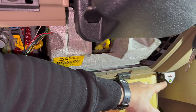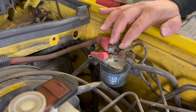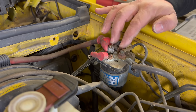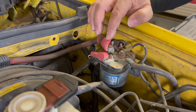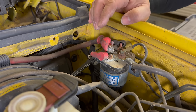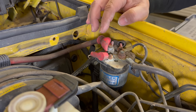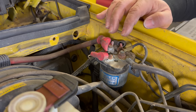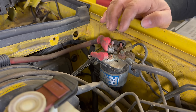So now we know how this works. When it's on emergency on, these two posts are connected together all the time — so both batteries are connected all the time. In dual battery mode, the two batteries are connected only when the ignition is on. That means when the ignition is off, if you have lights running or you're running a winch, it's only running on the original battery — allowing you to use your winch and not worry about restarting your engine. If you run that battery down too far, just switch to emergency on. Then you can turn it off and the alternator charges only the original battery, or switch to dual on and the alternator charges both batteries at the same time.